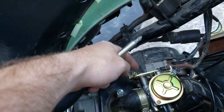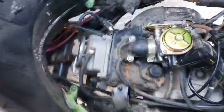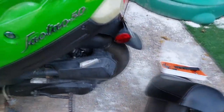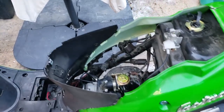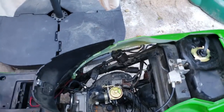I found what appears to be an idle adjust screw, so I can adjust the idle a little higher without messing with the throttle cable itself, which seems to work okay. Starting it up — it starts just fine where I have it adjusted. Seems like it was when I originally got it running, which is great, except if I crank the throttle and let it go it'll still bog down, the light gets really dim, and it may or may not cut out. I can pick it back up by giving it a little throttle.